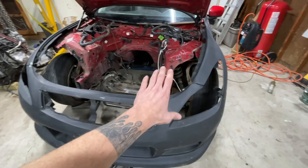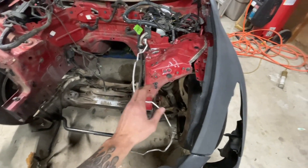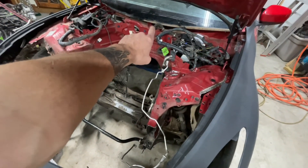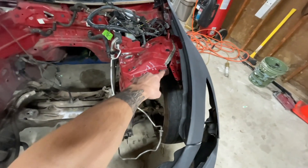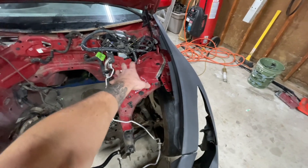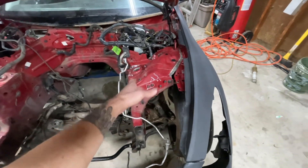Right now I'm at the point where the only thing I needed to do before I start putting this together and welding up this tube frame is I have to get this tower pulled out. It's only off 15 millimeters. I used my tram gauge that I made — a new one was like $400, so instead of buying one I went to the yard, picked up some metal, and made my own. That saved a lot of money. I was able to measure exactly the distance between these points. This side measured good in every direction, so I know that side's good. It's just this side — as you can see I straightened out our apron piece right there, got the wrinkles out of it, straightened it out, put it back on, and as you can see it does not line up very well. So this is off 15 millimeters over here, and once we pull it back to where it's supposed to be this will be closer. We just want our strut tower as close to spec as possible so that our alignment is as close to spec as possible.